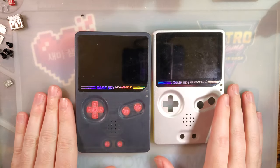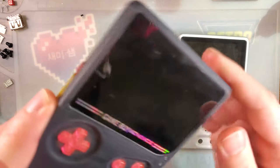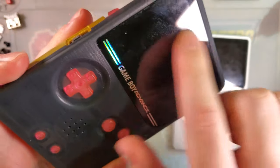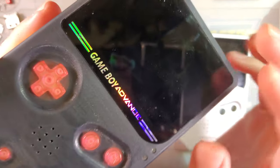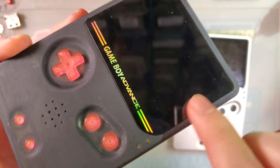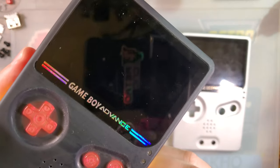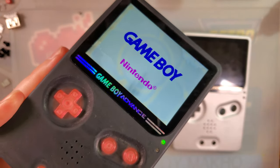We have two different options as far as lamination goes. We could go full lamination, where the glass is bonded to the panel with optically clear adhesive. You can see the bezel blends in quite a bit with the actual LCD itself because there's such a fine gap. Unfortunately, I messed up the lamination on this particular screen.